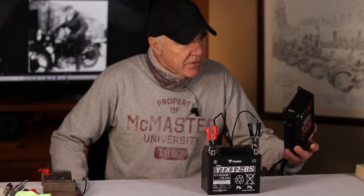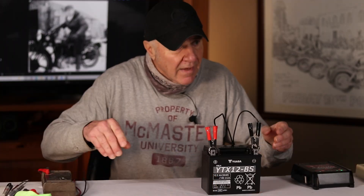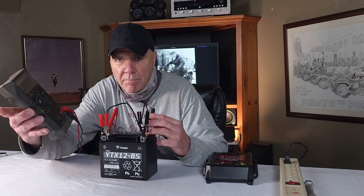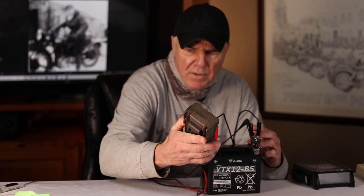Okay, that's long enough. Let's see where we're at. Now the charger has given us double green lights, which means we're hanging at maintenance voltage. So let's actually see what maintenance voltage is — and according to this meter here, maintenance voltage is 13.02 volts. So that's just about right in the pocket. That's where we want to be.